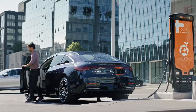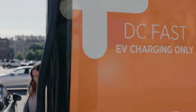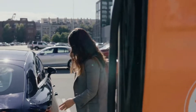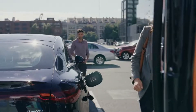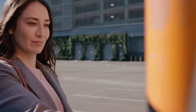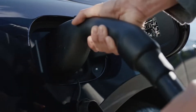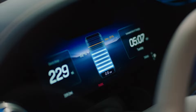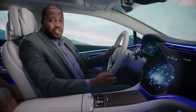Level three DC fast charge, which is the fastest charging option, is best when you need a quick on-the-go charge. Level three DC fast chargers can range from 400 to 900 volts, will usually say fast charge on the exterior, and use a larger plug and socket. These chargers can charge your car from 10 to 80% charged in just 31 minutes.